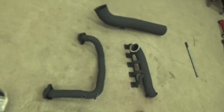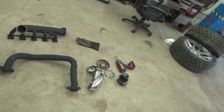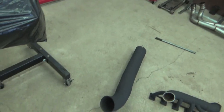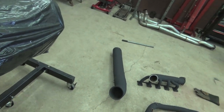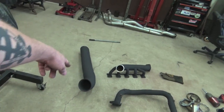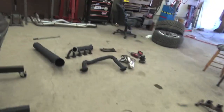Our ceramic coating job turned out actually really well and I'm happy with how it turned out. We didn't ceramic coat that one piece because it looks dope as is. Manifold, ceramic coated; crossover pipe and downpipe, ceramic coated. We'll also be wrapping the downpipe because of how close it gets to the PCM — titanium wrapped. I ordered new wrap and I think I'll just use the new stuff. So now we're just going to throw the whole truck back together. We got the wiring extension for the oxygen sensor installed, we just got to get it plugged in and everything put back together.